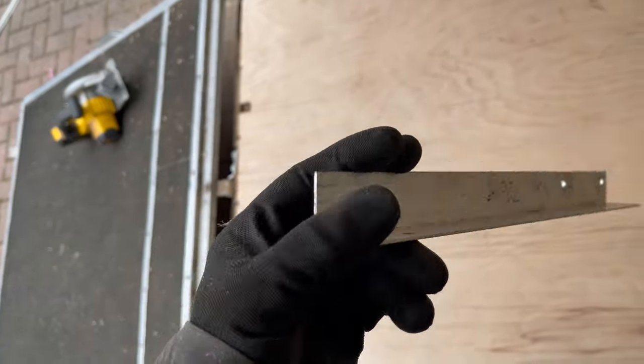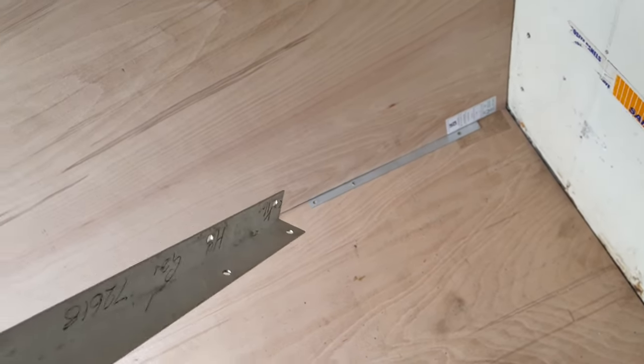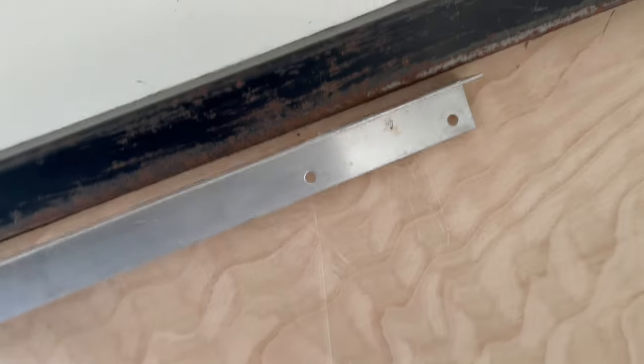What we were keen to do was improve the waterproofing and sealing around the edge. You can see putting out around the bottom there are bits of aluminium, and what I'm going to do is get some two-metre lengths of aluminium angle section - like this one on the bottom, those are just trial fitting - one along the top and put it behind the board, behind the ply so you won't see it. The reason for that is the strength of this wall is not hugely supported by this reinforcing bar, so they've put the bar on the whole side, and this plank is just attached by a few screws going through from the driver's cab. Obviously a lot of weight on this ply could easily push it away from the reinforcing bar, so with the aluminium angle sections I'm going to rivet it onto the steel bar from underneath.